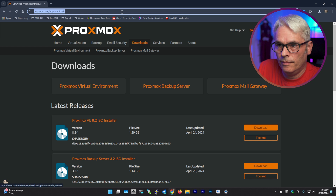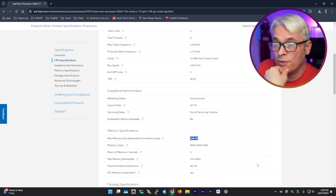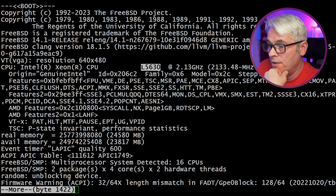The processor is the L5630 — so maximum memory is 288 gig. I'm not putting that much in there, especially when it's DDR3. I don't think this board will take it anyway. It's a Supermicro server. It should do nicely for a starting point — very loud, very very loud — which is fine once I put it in the right place.